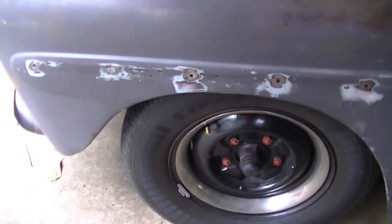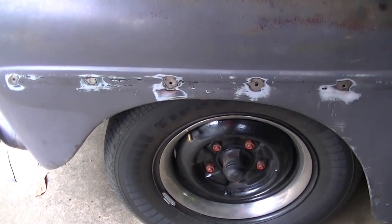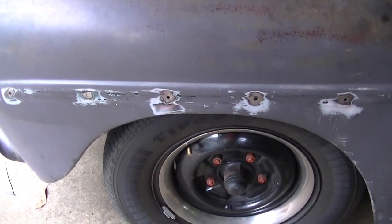Since I'm going to be trying to retain the wheel in the same position here on the '48 as it is on the Ranger, this is the center line mark for the '48. This is the exact center of the hub on the fender. Now the distance on the Ranger from this center mark of the hub to the end of the radiator support is marked here, very close to the front. But luckily, headlights and all don't need an incredible amount of room to operate.